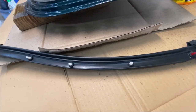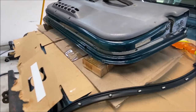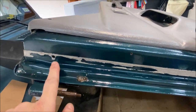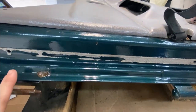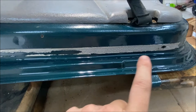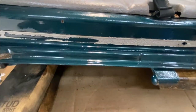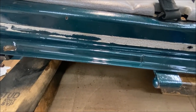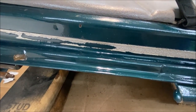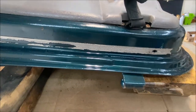I don't like drilling as much as I can avoid it, so I'm not going to drill additional holes — I'm going to remove the push pins that I don't need. On the face going to the front of the door, you can see there is a hole here and a hole here, but no push pin in the middle. I could drill a hole, but instead I'm going to take some less stringent, not quite as strong adhesive tape and put it here to hold the seal in place. Because really, when the doors close, there's plenty of pressure to hold the seal in place — it's really just to keep it from flopping off. I discovered when I did the other side that if you leave nothing here, it just kind of flops loose and you run the risk of it getting bunched up or torn. So I'm going to put some 3M automotive tape here.